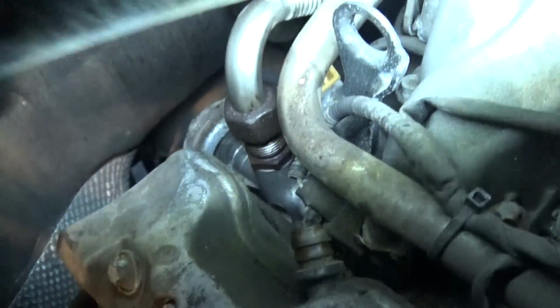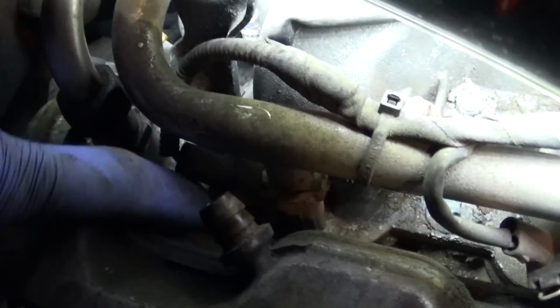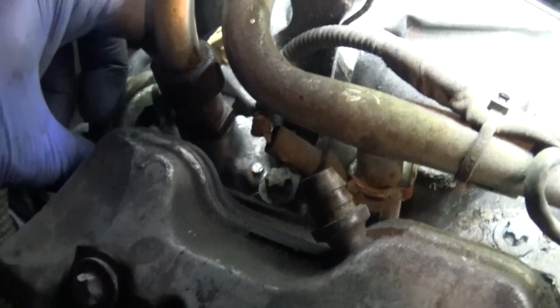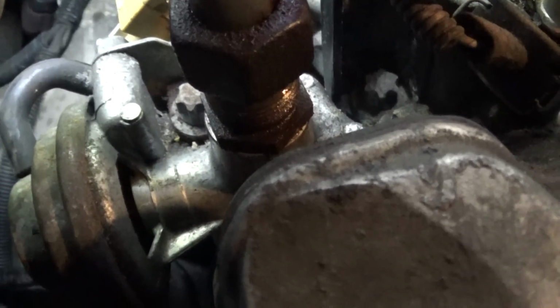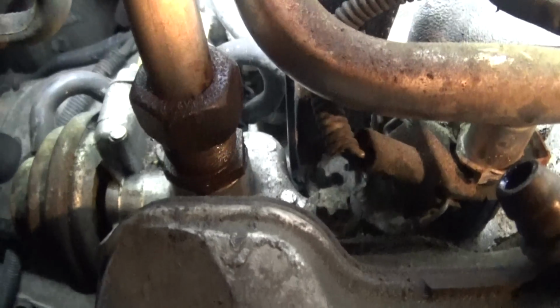And now the EGR valve itself, I found it has 2 bolts on the top. Let's see, there's one here, and one down here, right there. So I got those 2 loose. I'm not sure what sizes; I'll tell you guys, I need to figure it out. So that should be it. Once we get all that out, we should be able to get everything removed.